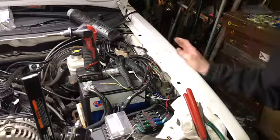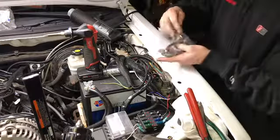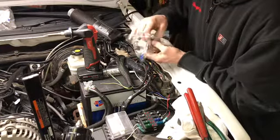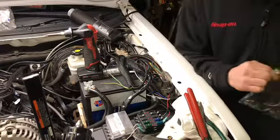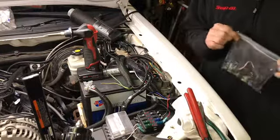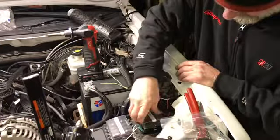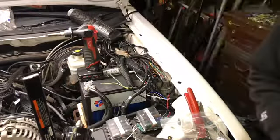So, give me 1 minute, I'm gonna pause ya. Okay. So I got a bag of fuses here. They were saying they wanted 5-amp draw. So I think I have both gauges, but the lights for the boost gauge are minuscule. So 5 amps should be plenty. So we'll put our fuse in. Pop our cover back on here.